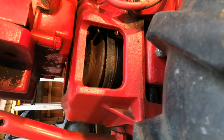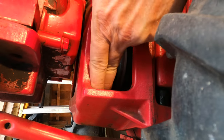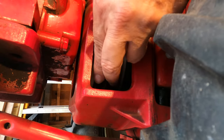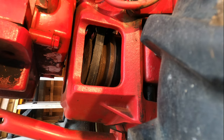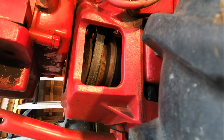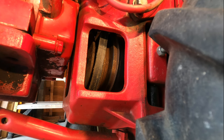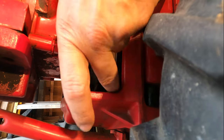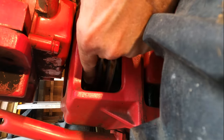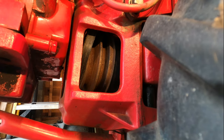And so actually the first thing you're going to do, and I'll see if I can do this without getting my fingers in the way too much, is just move that belt forward. But that's not forward enough. I'm going to engage reverse mode, like I showed, which brings the two pulleys closer together. And that throws some slack down here so you can easily get the belt off from the bottom. And now I'm going to throw it into forward drive mode.